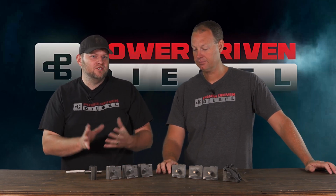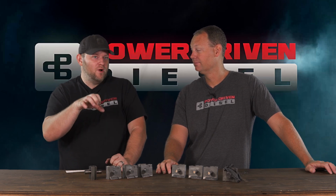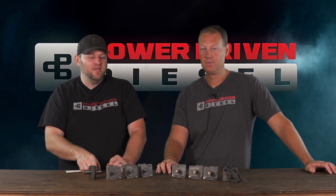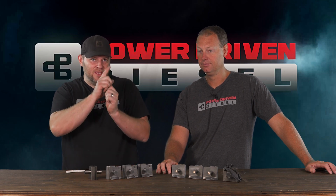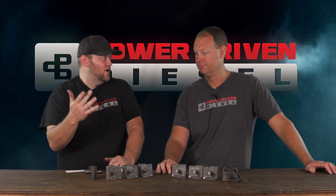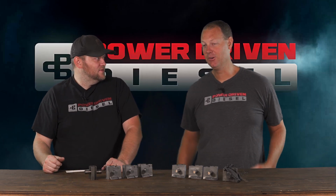Now, I don't want to say we're geniuses and we got this up on our own. You get in brand new 6.7 Cummins rocker pedestals, they've done the same thing. You get early 24 valve rocker pedestals and they have a single groove like this and they have galling. Now they've gone to this oil spec, Cummins has added the same groove we did.